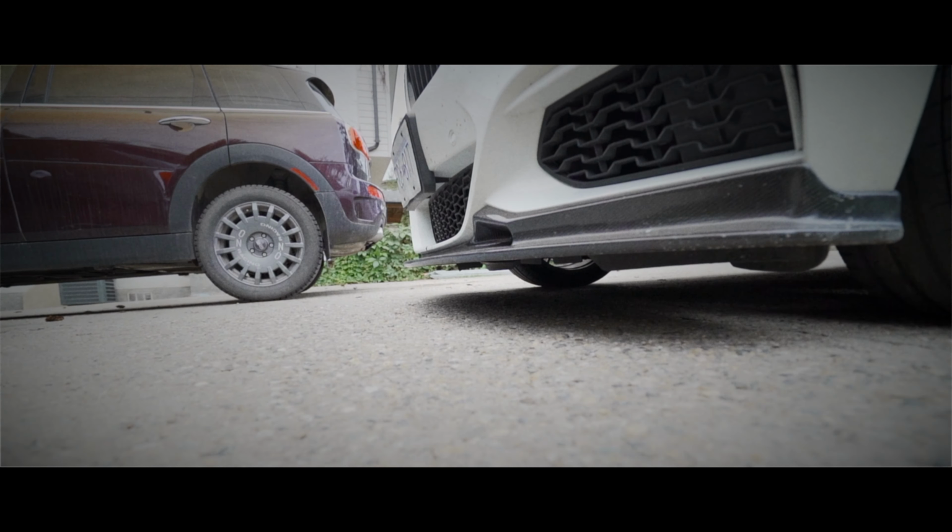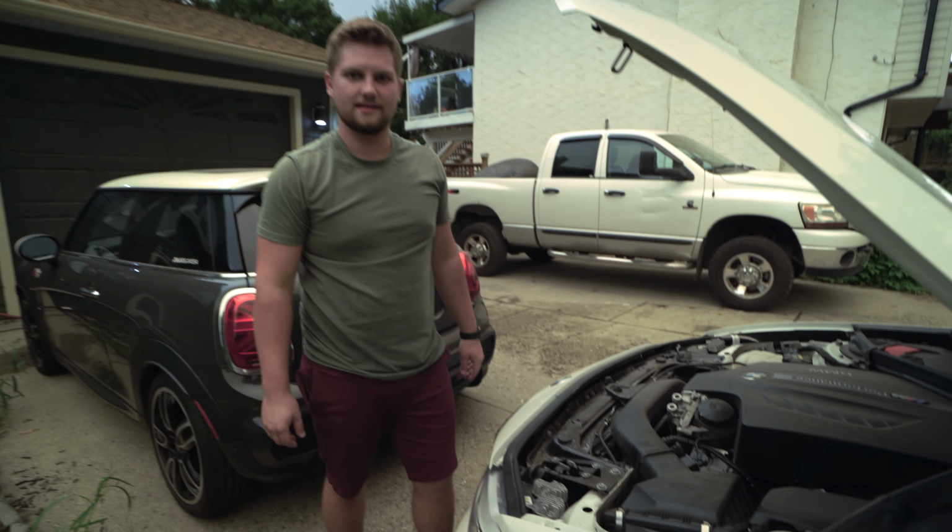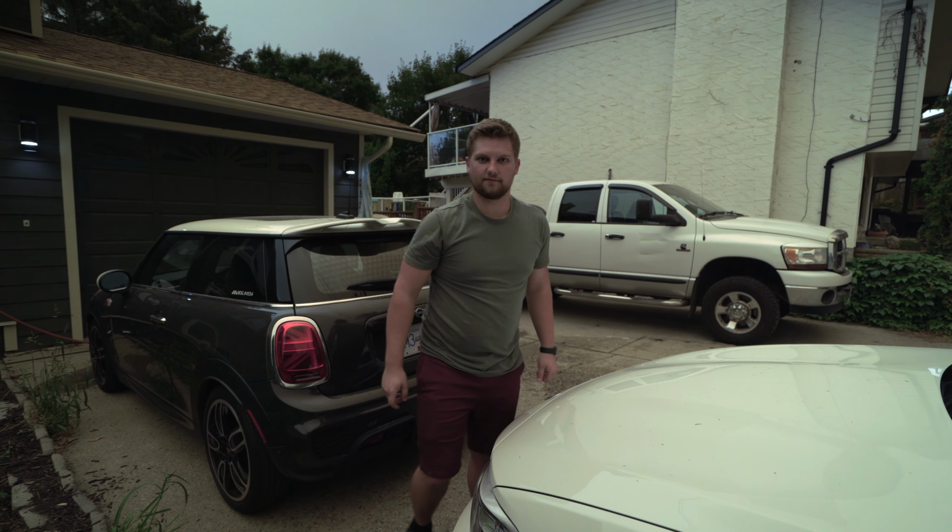And then, yeah, it's that simple, just pop it in. And I'm just going for a regular OEM filter because I don't have any performance mods on it yet, so I don't have any extra airflow. Although it's always great. Make sure it's all nicely seated down before you do the clips. And 1, 2, 3, 4. That's air filter done. Cabin air filter.